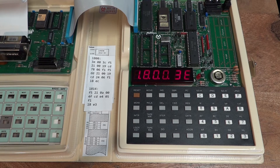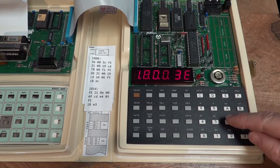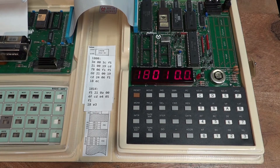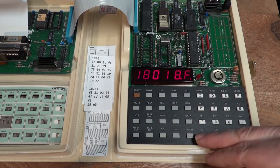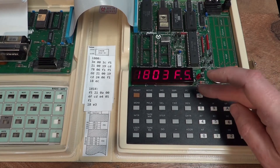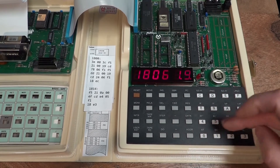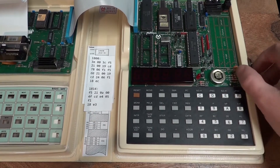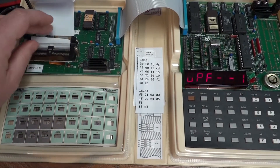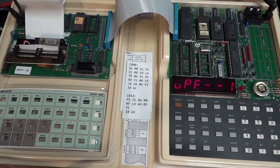This is characteristic of these machines — they don't make it easy. Even something as simple as loading the printer with paper might require some machine language programming. I'm using a jump to the line feed firmware routine at address 668F and executing it in a loop. Now you can see the paper is coming through. Let's pull it out a bit so it's straight — good, we are now good to go.